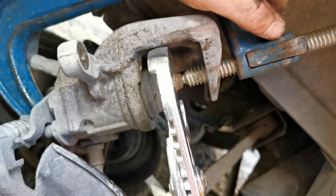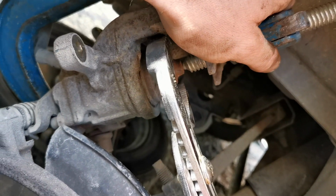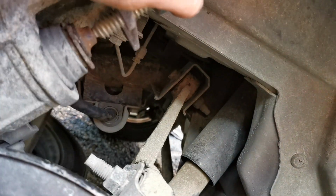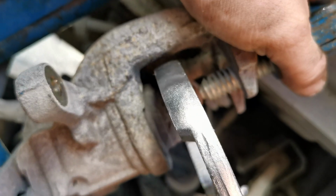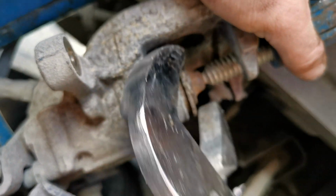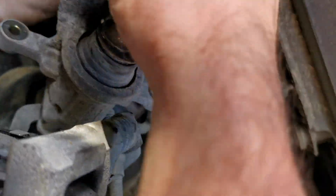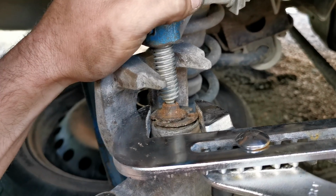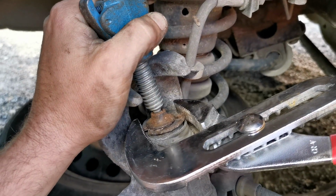As we see here, using a G-clamp, it's a good method, and these are screwing, so you need to put pressure on the piston and wind it as well. So this is where the slide grips come in handy. And you just want to keep the tension on and just slowly wind them back in. It's a better job if you've got 2 people, one keeping tension on the G-clamp while one's winding. That's unless you've got 4 hands.